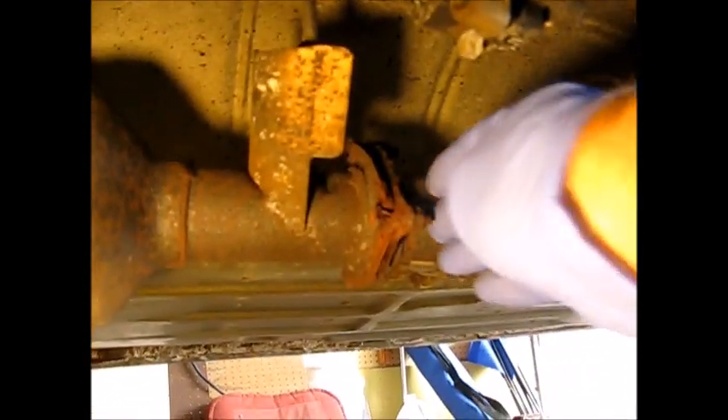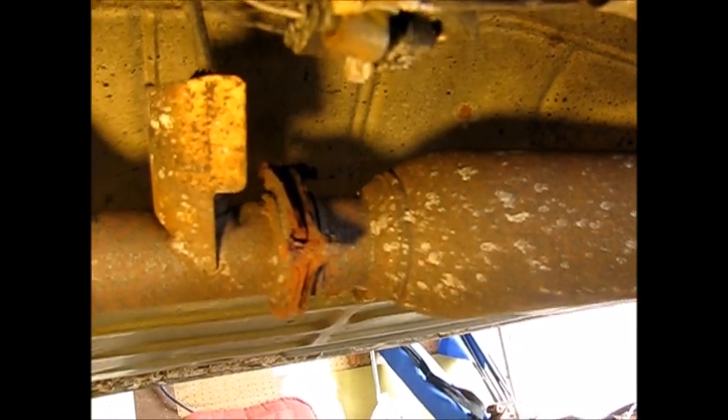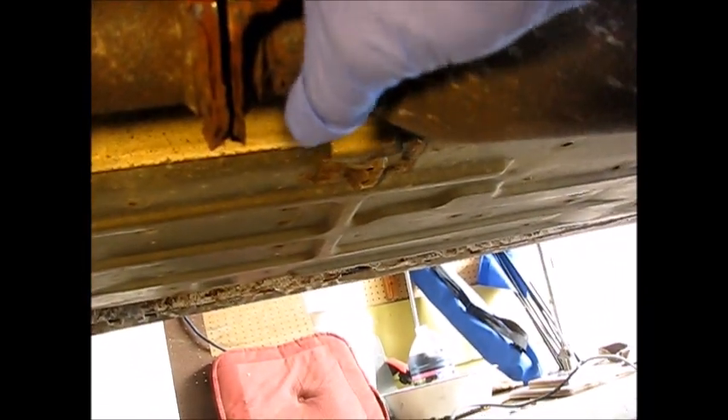What I'm gonna do is cut these apart first — remove this remaining bolt and maybe back this thing away so it'll dangle down a little bit, making it easier to cut. There's little I can do on the catalyst side because it's gonna just hang there. I think I'm gonna support it a little so I don't stress the connection up at the manifold, so I'm gonna stick a jack under it. I've got this one separated now.